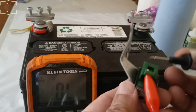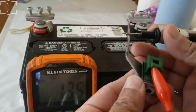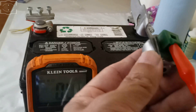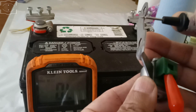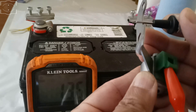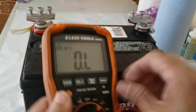Let me do it one more time. It is within spec — I'll also show you the Toyota software so you can be convinced this is the right way to test it. One more time — this shift solenoid has passed the first test. So let's turn this off.